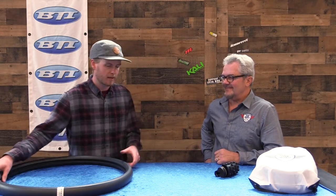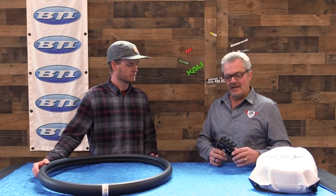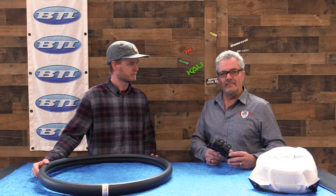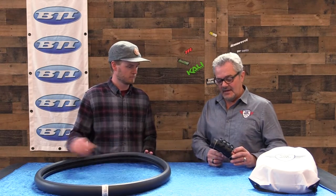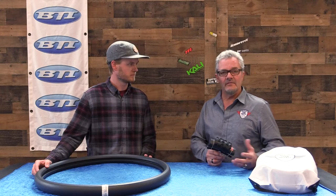Frank, tell us what's the main benefits of the product? We have a foam insert that's designed for tubeless applications for mountain bike. It is a foam rubber-based material, so the foam is very durable, has a certain amount of compression and rebound factor. It's designed to protect rims and add sidewall support to your tire while cushioning the ride over rough terrain.